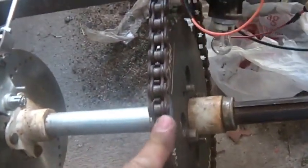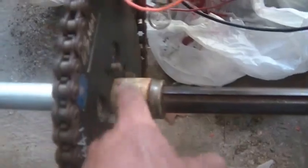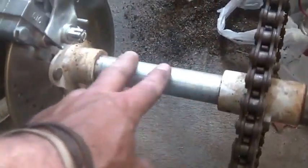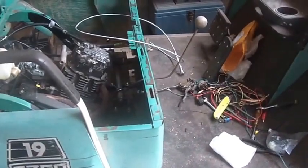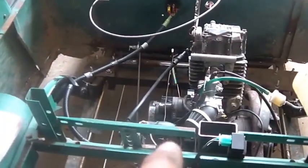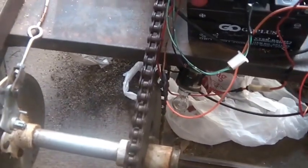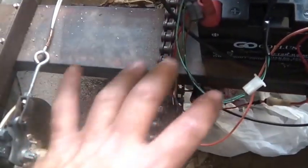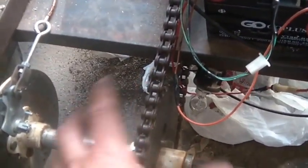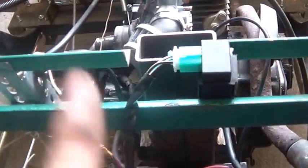I went with as big a sprocket as I could get my hands on — I think this is known as 520. The axle is keyed so I have a keyway for each wheel. I used conduit pipe as spacers so everything stays in place, rather than relying on Allen keys clamped to the axle. This is a Honda TRX 200SX engine, obviously chain drive. The TRX 200SX is known for getting a lot of play — it's kind of narrow in the back between the bearings, so there's a tendency to get play, throw the chain, and damage the case. It's really hard to find a TRX 200SX with a decent case.